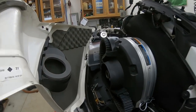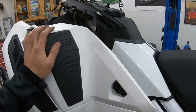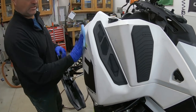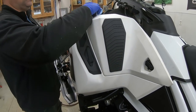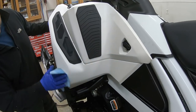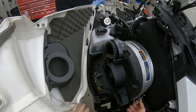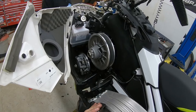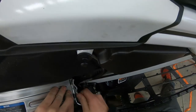Obviously you'll have to unclip it when you have the hood on, but basically the air will get sucked out of the vent and be pushed out through the panel. People are saying it won't work because there are no fins in the secondary, but the dealer says BRP has done tests and even without fins on the secondary, heat still gets pushed out and cooler air gets sucked in through here from the primary drive clutch. For $80 I think it's a good deal — and besides the cooling issue, it just looks good. The way this new guard comes off is so much easier compared to the old one; this one slides on like it's nothing, just like the old XP and XS chassis.